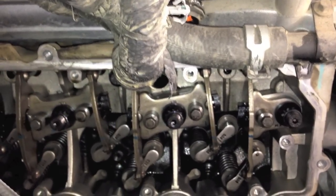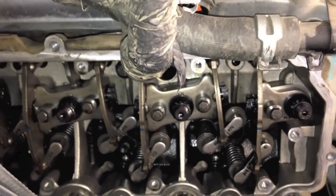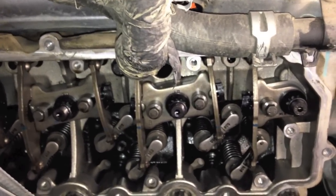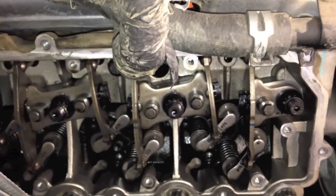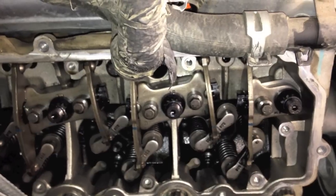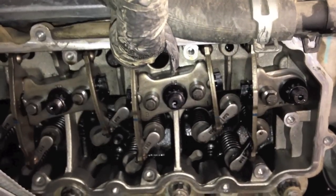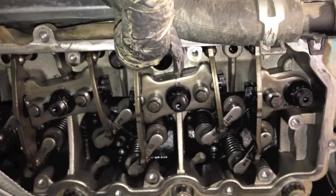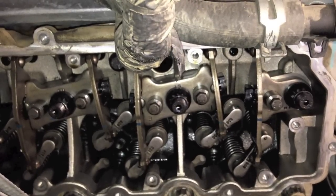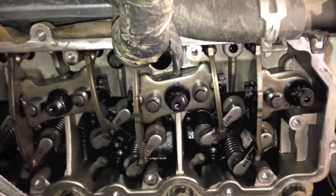Now I'm checking the passenger side. A couple of pointers: pay attention to cylinders three and five, pay attention down low by the glow plug area right above the cup, and also right by the exhaust valve - so the top of the cup and towards the glow plug, more or less around the six o'clock position. On this side I'm doing it the old-fashioned way that Ford has us doing it - removing the injectors, taking out all the water, and pressurizing the cooling system, so it's the same thing but without the air bubbles.